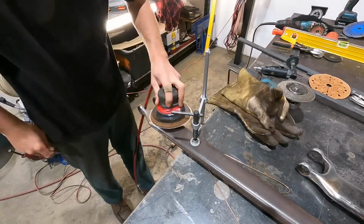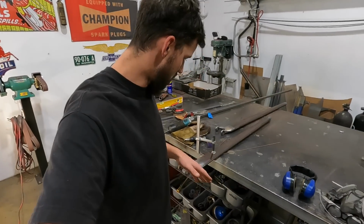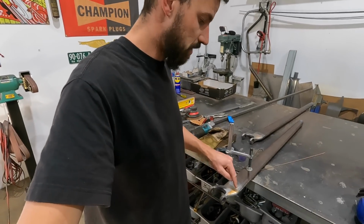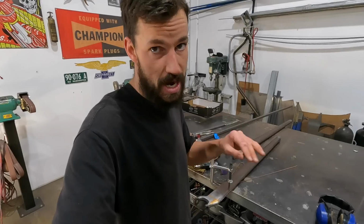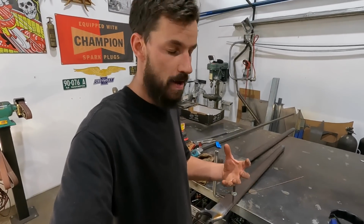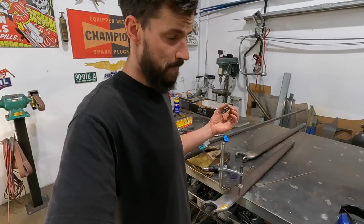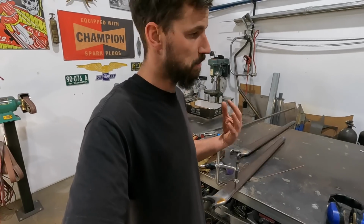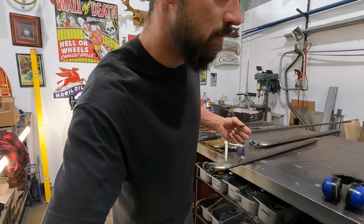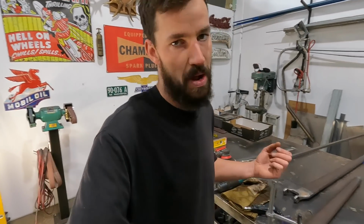Okay, so I just wanted to show you something as well. I've showed it in previous videos, but using a little bit of silicon bronze just to kind of fill those areas. It's not actually part of the weld, if that makes sense. So I've already done 2 passes at a really good temperature. I was putting in, I think, over 140, 150 amps, but on the pedal though.